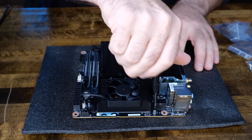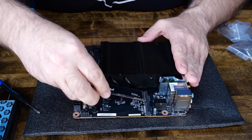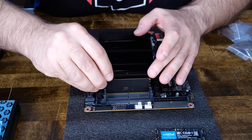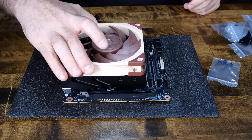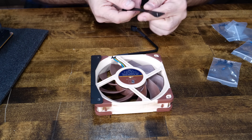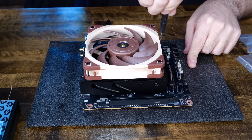Now it's time to put all the hardware into our newly hand-built bespoke artisanal 3D printed case. I prefer to build out the motherboard before placing it in the case. We'll start by removing the NVMe cooler from the board, installing the Crucial P3 Plus 2TB NVMe disk, and then the Rytop M.2 to SATA 3.0 adapter. Then onto the Crucial DDR5 SODIMM RAM — first stick, then the second. Easy peasy. Now let's install a 120mm heatsink fan — a Noctua NF-A12x25 — using the two simple metal brackets included by Minisforum, secured to the heatsink on the motherboard.